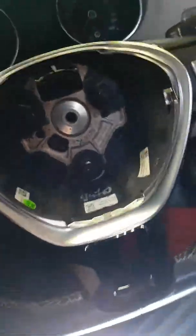Whenever you're putting your airbag down, put it down on the floor with the airbag facing up. If for whatever reason static discharges the airbag, or on the remote chance it does deploy, the airbag side needs to be facing up so it doesn't send the back of the airbag through your windscreen, through the roof, or through your face.